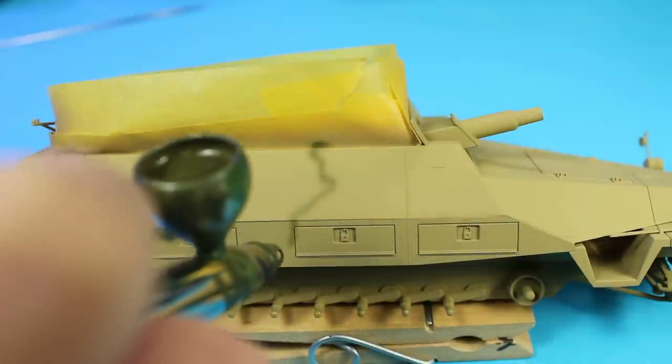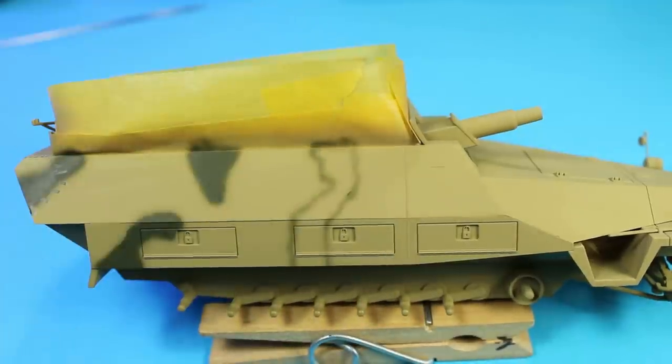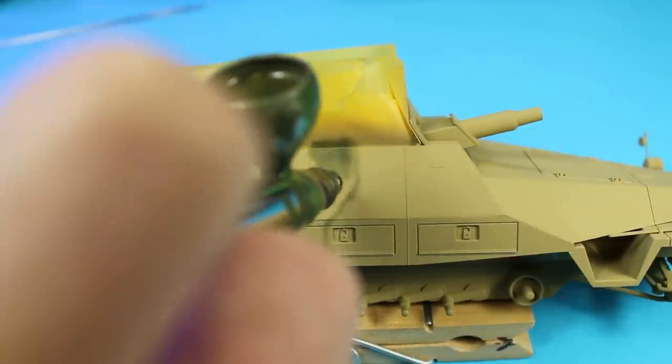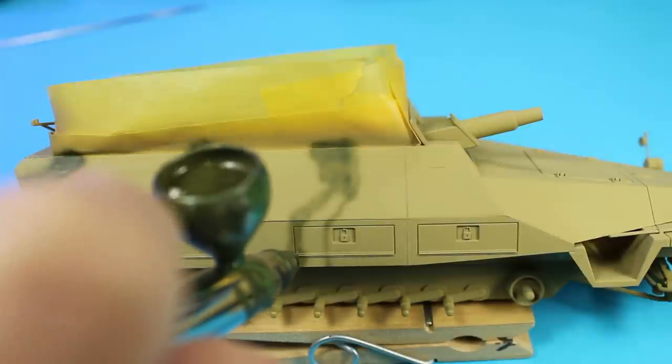And we come back around, and once it's dry, then you can just lightly sand it and just spray over it, and it'll be gone. But if you try and rub that away, you'll have no end of problems. You will wipe all the paint away underneath. You'll have a great big divide in the non-painted and painted area, and you'll get loads of problems.